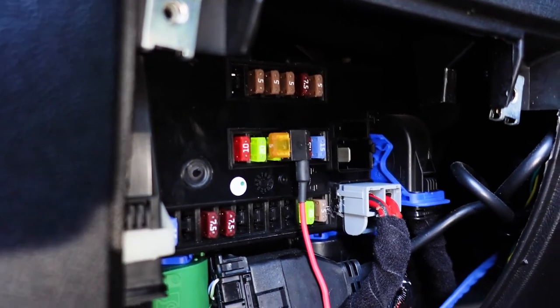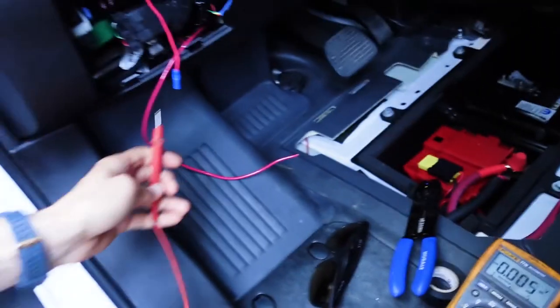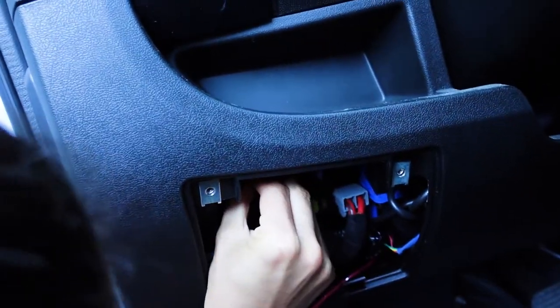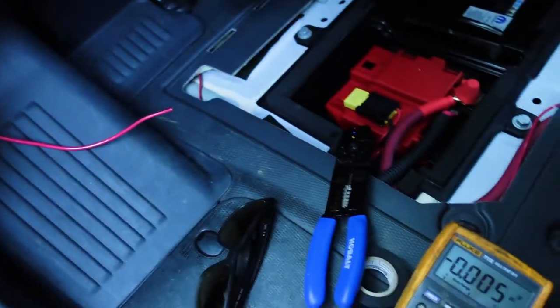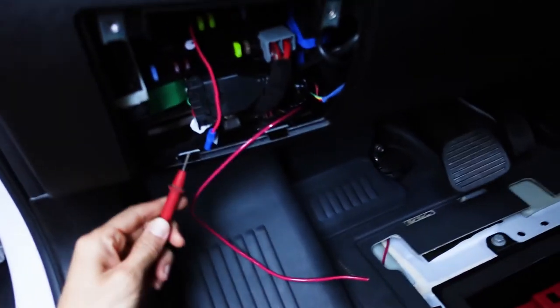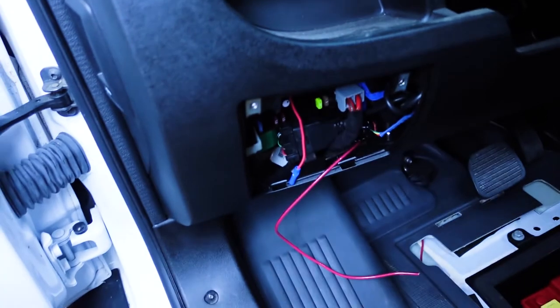This is to show you what you don't want to see when you hook it up to a voltmeter — this is us plugged into the fuse that we're not going to be using. You'll connect the positive side into the wire and then ground the negative. This is with the ignition off — it's reading 12.22 volts. So we'll unplug that and stick it in the spot that we're going for. It reads zero — and that's exactly what you want to see. If it's reading anything with the ignition off, that is a no-go spot; search for another area. Recheck it with the ignition on — we have the juice. We are good to go.